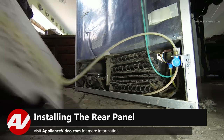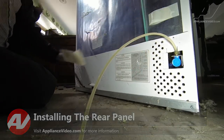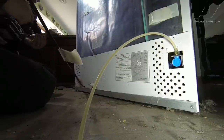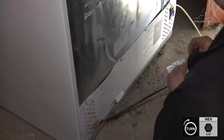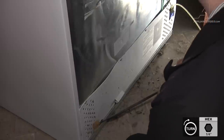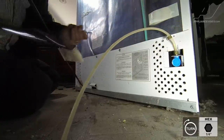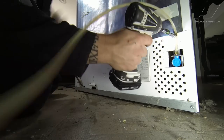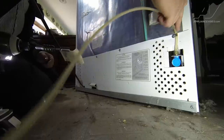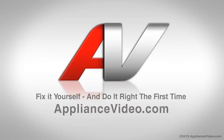We checked for leaks — everything checks out okay. Now we just reinstall our back cover, push it into place, and put in the screws to secure the back panel. The final screw is a little different: they didn't have a strain relief for the water line, so to remove liability we're going to install one. That way when the refrigerator is pulled in and out, the strain is on the relief rather than down at the fitting. That completes the repair for the inlet valve and the diode. Thank you for watching another quality video brought to you by ApplianceVideo.com.